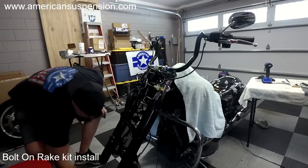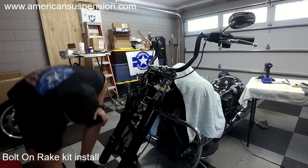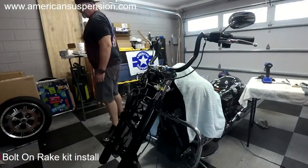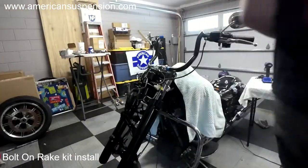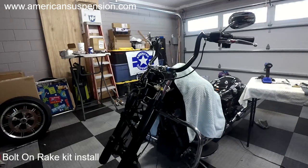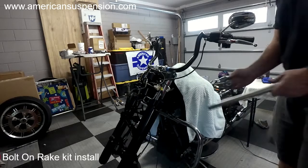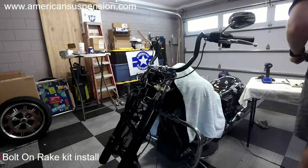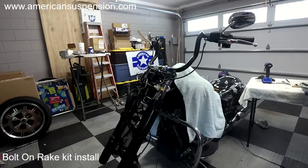You're going to need the spacer from the stock wheel. Then you're going to need our axle, or if you use the stock lowers, you'd use the stock axle. I usually put some anti-seize on here for ours. Put it on the threads on the end, like this. And I put some grease on the axle shaft itself. And this is 3/8 also.